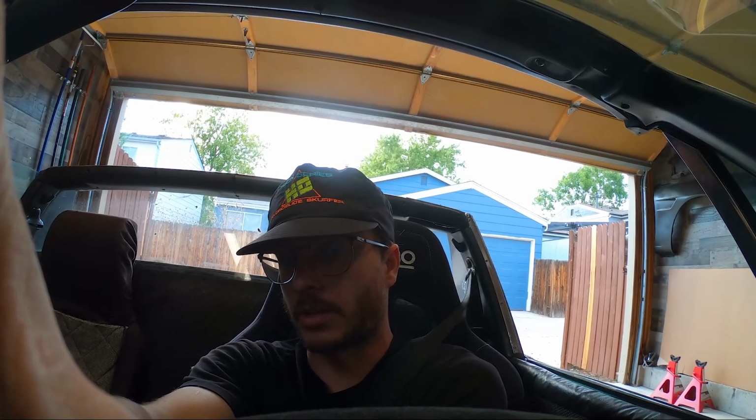Definitely driving significantly nicer with the suspension raised up, and I was just able to pull front into the garage on this side without scraping the oil pan, which is awesome, because before, the oil pan's reinforced with like 3/8 steel on the bottom, so I wasn't too worried about banging it up, but it would literally stop the car. It was scraping so bad. So that's good, and the car just seems to drive nicer, even with an alignment needed, at this ride height.